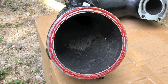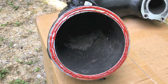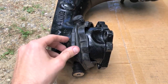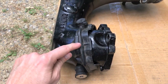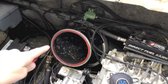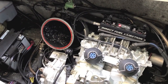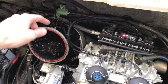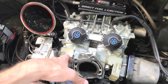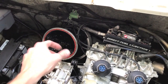Next we have to apply the high-temperature red silicone gasket maker — we chose the JB Weld brand. There is a linked video at the top right to walk you through the step-by-step on how to do it. Don't forget to take the rubber pickup envelope off the old manifold and insert it properly on the new manifold prior to putting this new manifold in. We also ran a bead on the surface or face of the lower manifold where the copper ring will be inserted. When you insert the actual manifold, do your best not to tug and move the upper manifold — the more you move it during tightening, the more likely you will mess up that bead, so be very careful.